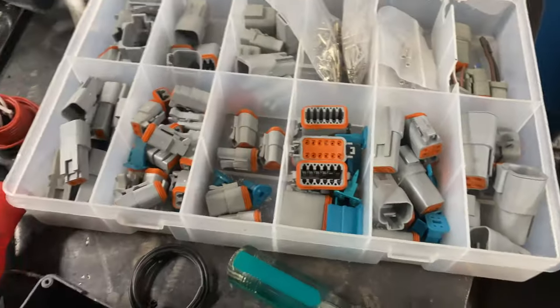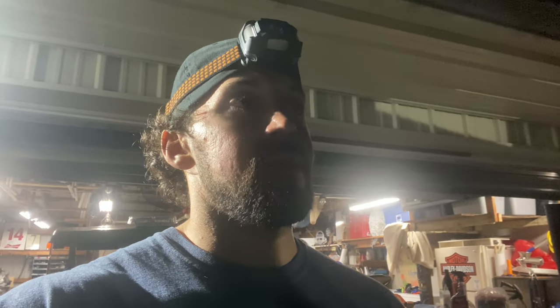So I was able to use it and cut out all the bad wiring that was all charred up that goes to the fuel rail. I put some fresh wires in there, was able to solder them together, and then add the Deutsch connector, and that should be good to go. So now I'm letting the batteries charge up tonight, but everything's full of coolant, wiring's good. The engine and everything should be ready to rock and roll.